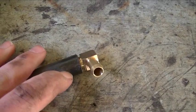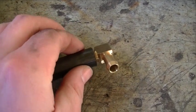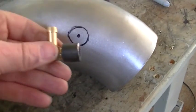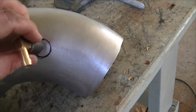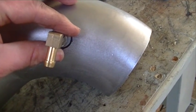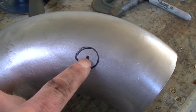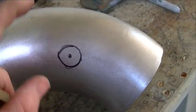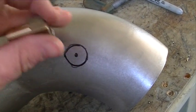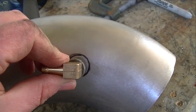In the meantime while this is cooling off, I'm going to go ahead and cut off the little bung here from this piece of DOM tubing, because this is the next thing we need to do on this project. I've cut my little bung and put the intake tube back on the truck so I could place this underneath here, right by the throttle body, just to make a mark of where I'm going to put it. Now I've got to come in here and drill a hole — obviously this crankcase ventilation is not going to work unless there's a hole through here so that the vacuum can pull those crankcase gases through. I'll drill out this hole and then we'll be ready to weld this little bung onto this tube.